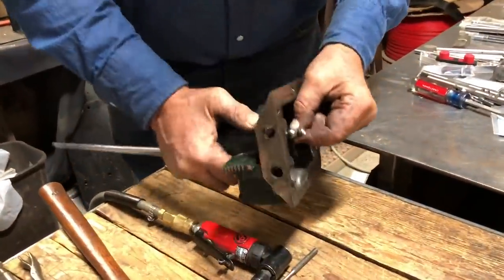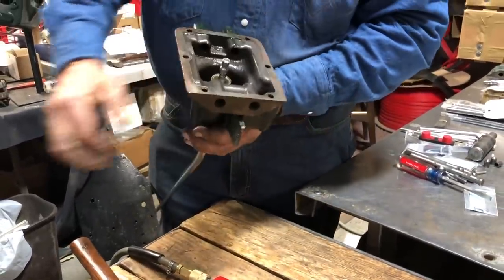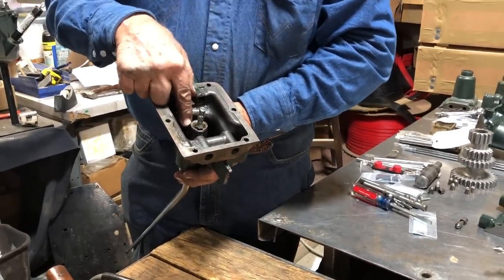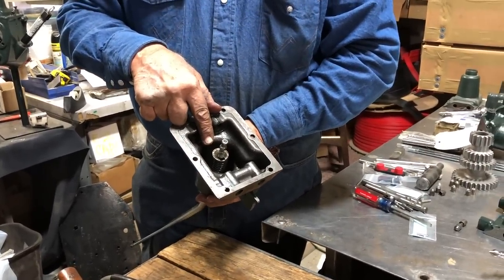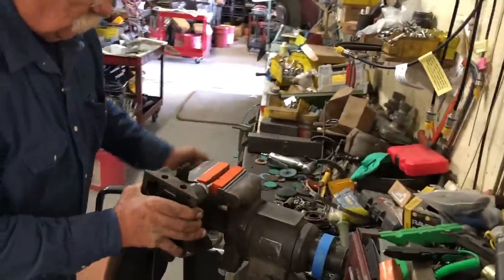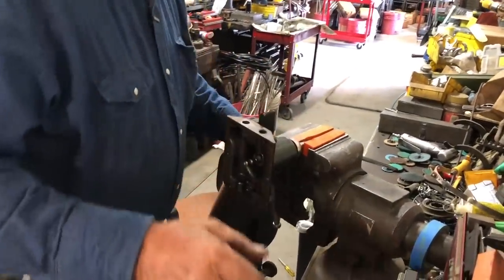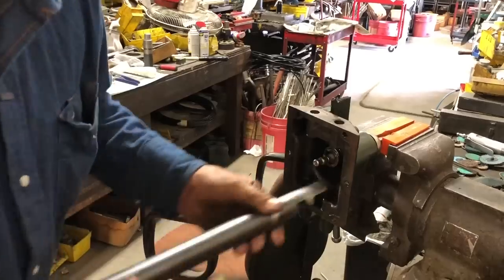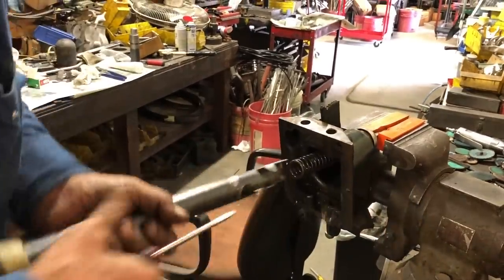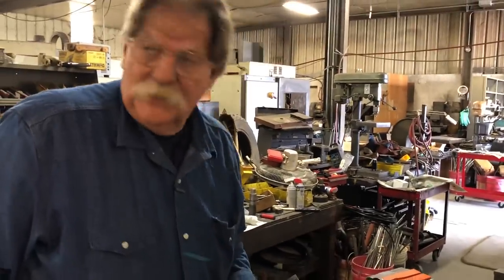This lets you inspect the ball — this ball is actually pretty good, but you'll see them in a clearly flattened condition. If you want to pull the stick out, it can be an exciting process — everybody knows about the spring of death, right? That spring will fly 30 to 40 feet and it has great power. I have protector pieces in my vise, or you could just simply put a piece of garden hose or wrap it with a rag. To get it out easy, I shift it around, go in alongside it, hold the pressure, pop your spring off — and nobody died.